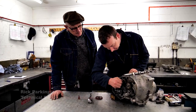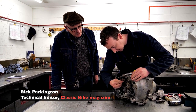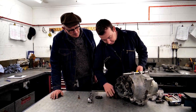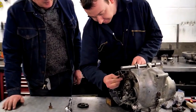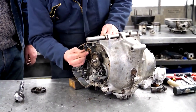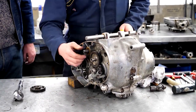The problem with the camshaft is that you've got a side-to-side play, and it's just a sign of either a bush worn or the cam itself — usually both to a certain degree. So we'll inspect the cam when it comes out.